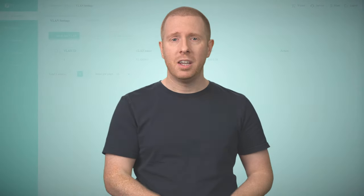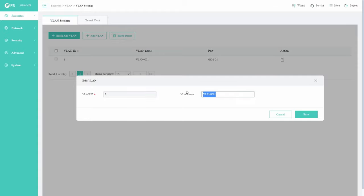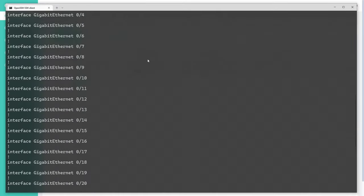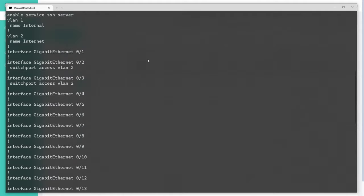The way I would approach this is to start with the web interface. What you can do is click your way through the options to configure something, then inspect the configuration you generated to see what it actually looks like. That's a good way to learn about the capabilities of the switch as well as start learning about the command line, because a lot of the config generated is basically what you would have typed into the command line. So let's set up some VLANs. I've reset the configuration for this demo, so don't get too excited when you see passwords in the config.